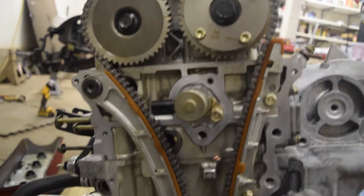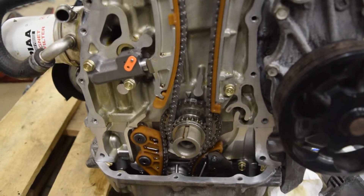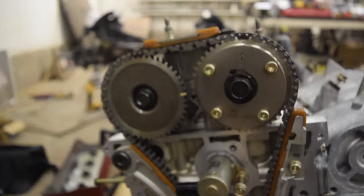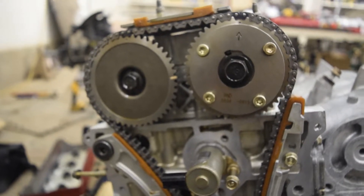Timing all lined up. Scraped all the gasket off the engine. I still gotta scrape it off the case. Timing chain is actually a lot easier than the timing belt, especially with the help of these. You can fit a wrench in there — I believe it's a 24 millimeter, but I use a crescent wrench. You can actually manipulate the cams. That made it easier to line it up instead of trying to just muscle everything with my hands.